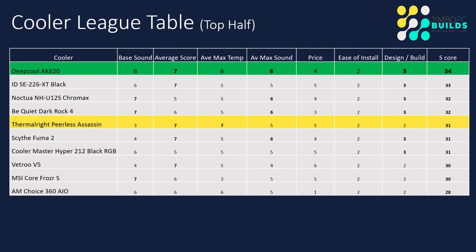The Thermalright cooler - what are my final thoughts? The first thing I'm going to lead with is the price, because this is a two-fan cooler that cools to 57 Celsius on a pretty warm CPU - the 10700K, which I continue to use because it does get quite warm. And it does all of this for under $50. So although the cooler looks a bit bricky and the installation's a little bit more fiddly, for what you're paying - wow. You just can't knock it.